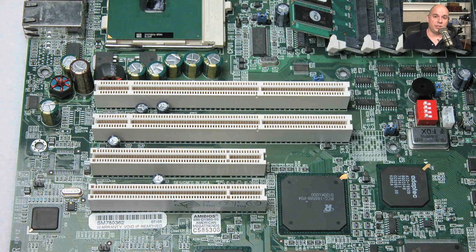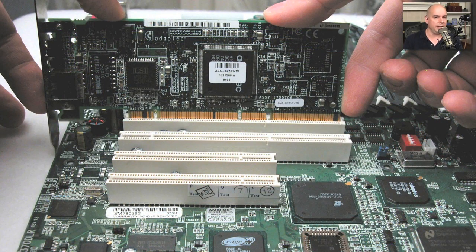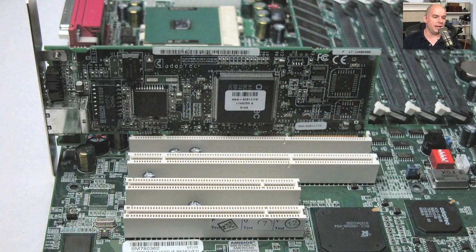The physical process of installing an adapter card onto a motherboard is relatively simple. You have your adapter slots on your motherboard, and you've already purchased a card that you know is compatible with and fits into the slots available. Simply place it on top of one of those adapter slots and give it a gentle push down — it doesn't take a lot of pressure. But you want to be sure that it goes all the way into the slot, with the copper contacts fully seated inside the adapter slot, so that when you power on the system it will be working exactly the way you'd expect.